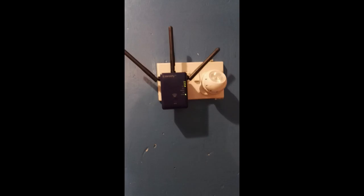Right, so I just need to tell my phone to keep the current connection. It's trying to connect back to TalkTalk because it knows I've got no internet connection at the moment. The channel one is the one that works best in the place where we want to locate the repeater. So I'm going to put that in there. And then the Wi-Fi key is there. So just put that in and press go. And now the device will take the settings, reboot, and then when it reboots, it will be connected to my network and ready to repeat.